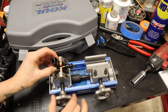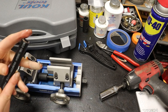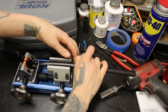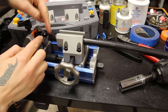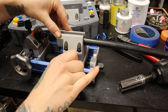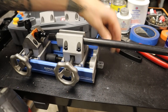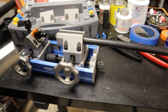I'm just going to place this fitting in this side here. Normally these push locks are not that difficult and you can do them by hand. However, this high-performance one has a really, really stiff wall, and it's actually pretty hard to get on — I'm weak, so. When you place the hose into this portion of the tool, you want to make sure that there's quite a bit protruding. This tool is so extreme — if I cannot tighten this tight enough just by hand, you can also use a 17mm socket on this thing. The same socket that I'm using to tighten and loosen it here, I could get a little extra help. This thing is so over-engineered.